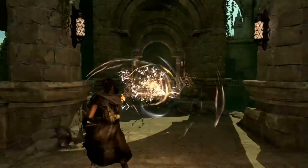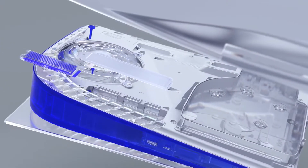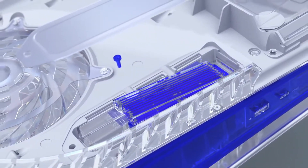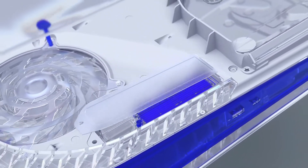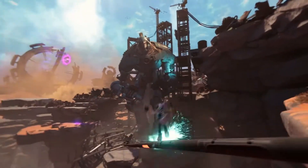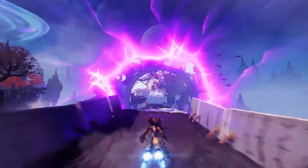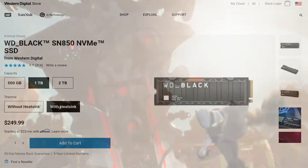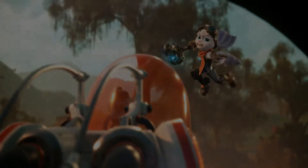Using an M.2 SSD with your PS5 console requires effective heat dissipation with a cooling structure, such as a heat sink and a heat transfer sheet. You can attach these to your M.2 SSD yourself, either in a single-sided or double-sided format. There are also M.2 SSDs that have cooling structures such as heat sinks built-in. The WD Black SN850 M.2 SSD that I'll be using is compatible with the PS5 and already has a heat sink attached.